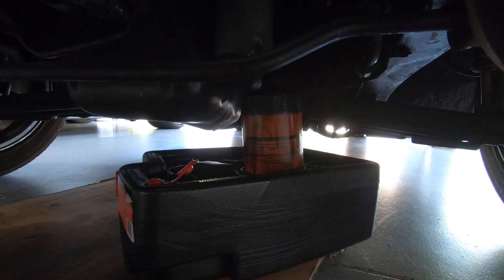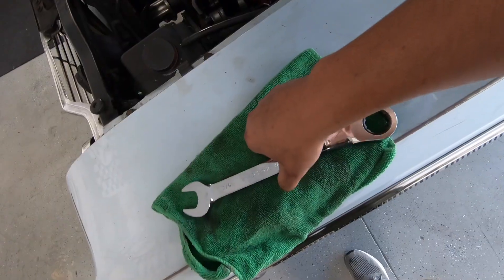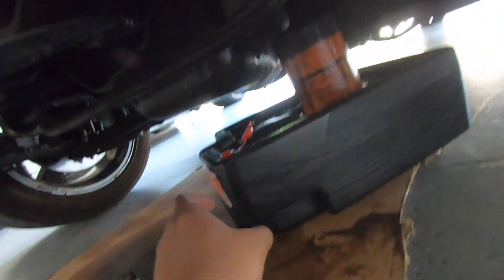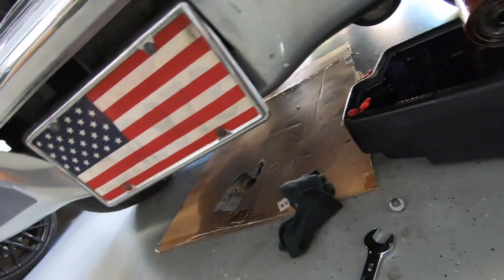I should be able to put that drain plug back in and put the new oil filter on. Next thing we need to do is put the gasket on that bolt and get it back up into the oil pan down here. We got a small little drip, but we should be okay. I want to wipe everything down to make sure if there are any leaks I can tell where they're coming from — there's a few years of grime down here. We should be good to put this drain plug back in. Again, these don't need to be super tight, just enough to seal it — you don't want oil leaking but you also don't want to strip that bolt.